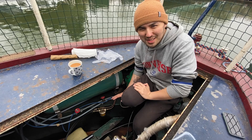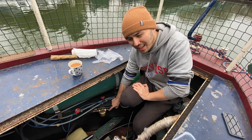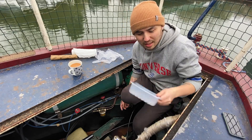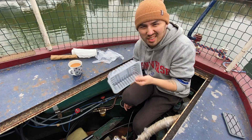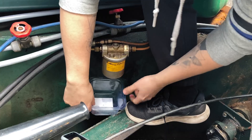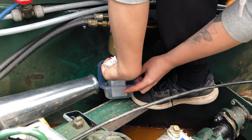So as far as our knowledge goes, this is basically the water filter — it's the first filter your fuel goes through to the engine and it will just take out all the moisture. You just need a little tray or something to catch anything that drips out of it. Some separators come off entirely, but for ours there's just a little twisty thing at the bottom and we just turn that until a small amount of liquid comes out to form a small puddle, and then tighten it back up again.